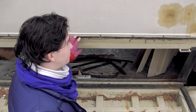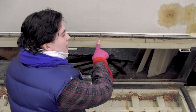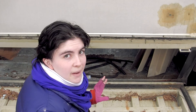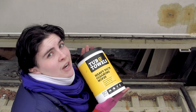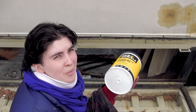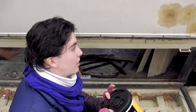So I just have to re-adhere this part to this part with new construction adhesive, joining the two pieces together, and then I'm going to caulk over the line of construction adhesive as well since this part definitely needs to be super watertight. The first thing I'm going to do is take a cleaning wipe — most of the time I try to use soapy water and a towel so I don't run out of wipes since they're more expensive, but for something like this they're really handy, so I'll go ahead and use one.